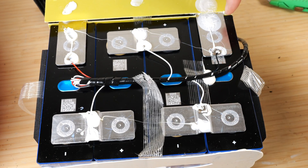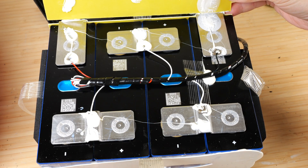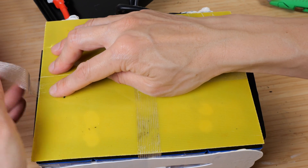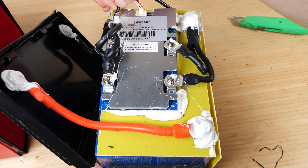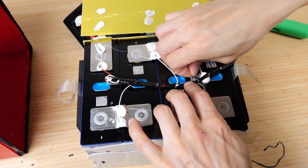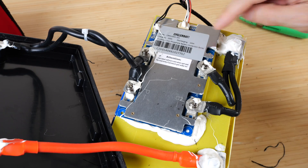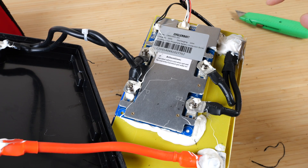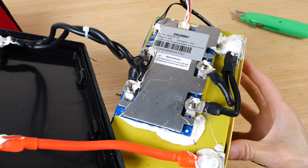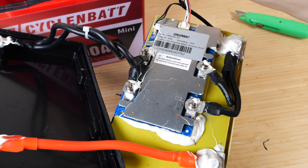The terminals are welded in place in series. It appears I'm not going to structurally affect anything if I just put this back on without gluing it back on — it won't be on there as well as before. There's also a temperature wire that goes in here, and the temperature probe is actually over here — the bi-metal thing. There's only one temperature probe on this thing. They use a lot of caulk on everything, including on the terminals, gluing the boards together, and gluing these fiberglass boards on top of the terminals. That gives a little bit of extra heat protection because it contacts the shell and might melt it if it gets too hot.